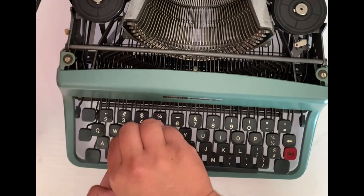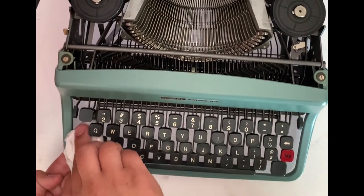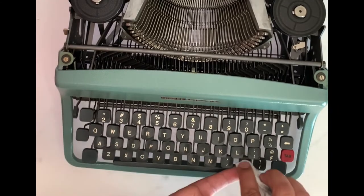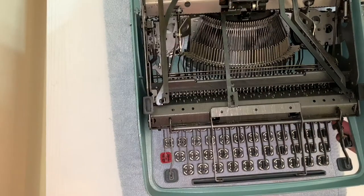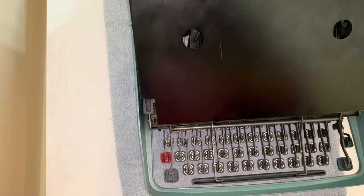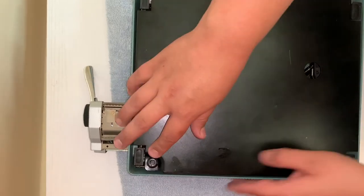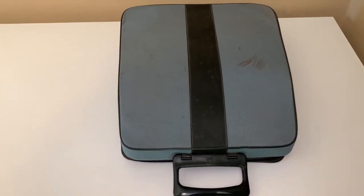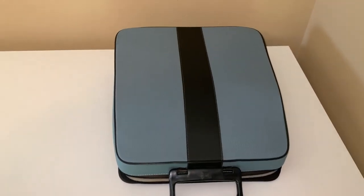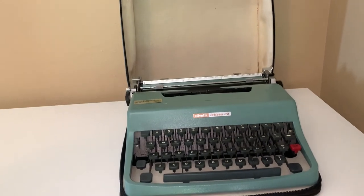Now take the same thing you were using to wipe down the outside and clean up all the keys. This is going to be the most satisfying thing you do. Make sure to place a finger underneath to support the keys as you're cleaning the top, and you will be surprised how much old gunk, ink, and finger schmutz is on these keys. Now place the bottom back on — there are slots that easily clip in. You can type without this on the bottom but it isn't great for long-term use. Last but not least, take a hot water and soap solution and clean the outside. Alright guys, there you have it — here is your clean Olivetti Lettera 32. I hope I helped; if you have any questions just leave a comment below. Happy typing!